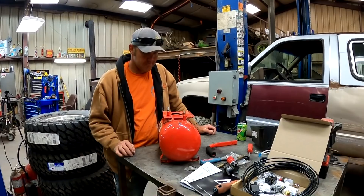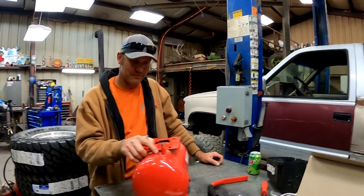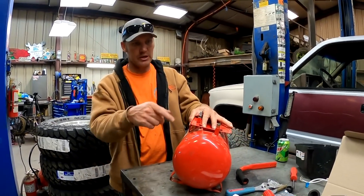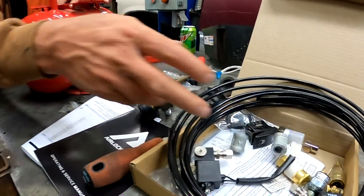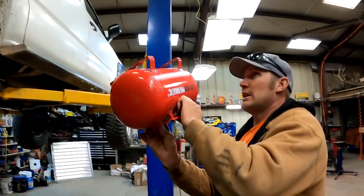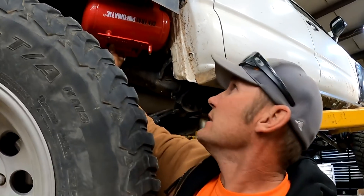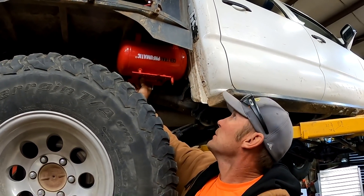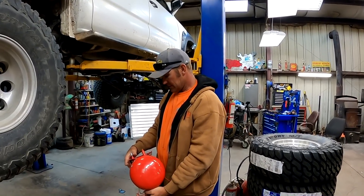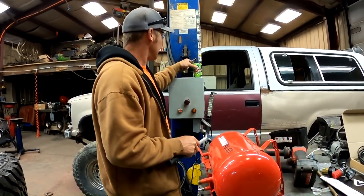Tonight's project is air. I got to take this good old Central Pneumatic tank that I picked up at the dump — it's gonna turn into my air tank. For that I gotta cut this plunger off the top, put a couple new fittings in it, plug up a couple holes, and then mount it right up in here. The tire's gonna barely clear it. I'm gonna put my air compressor up on the bed in the back and build a little cover for it so it stays out of the mud.